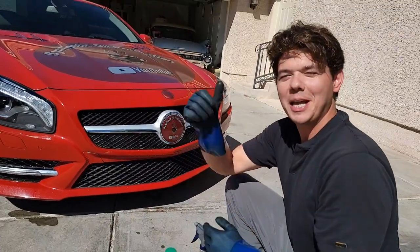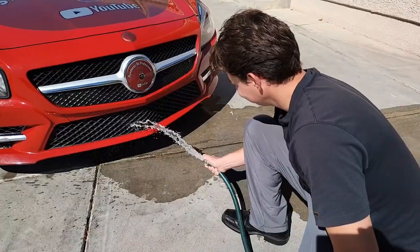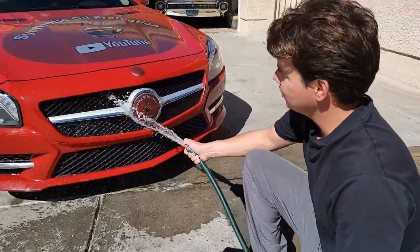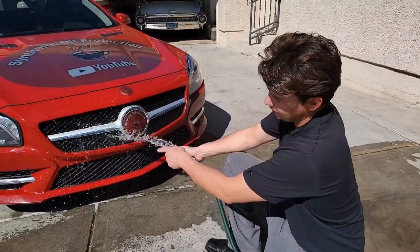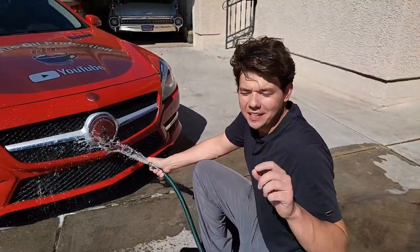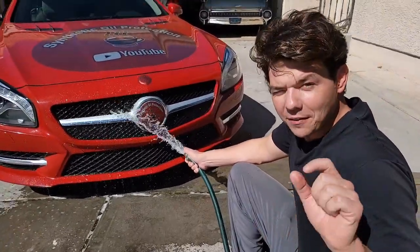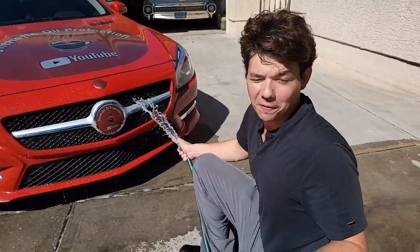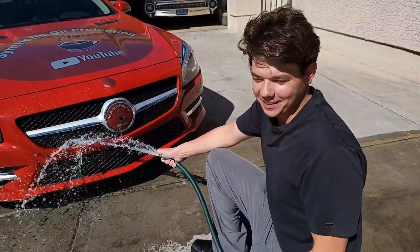If you want to really clean it even better, you can use a foam called Coil Cleaner — it's for condensers and air conditioning units. It's a small can, water-soluble, pet-friendly, and biodegradable. Highly recommend doing this every single summer. If you want to be super diligent, you can take off the belly pan and clean each fin with a little toothbrush, or use a metal pick to straighten the vents if you want your radiator to be almost perfect.